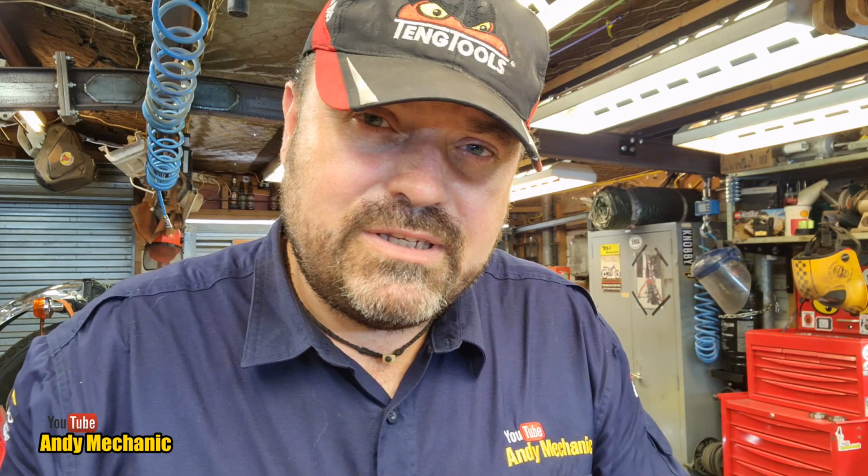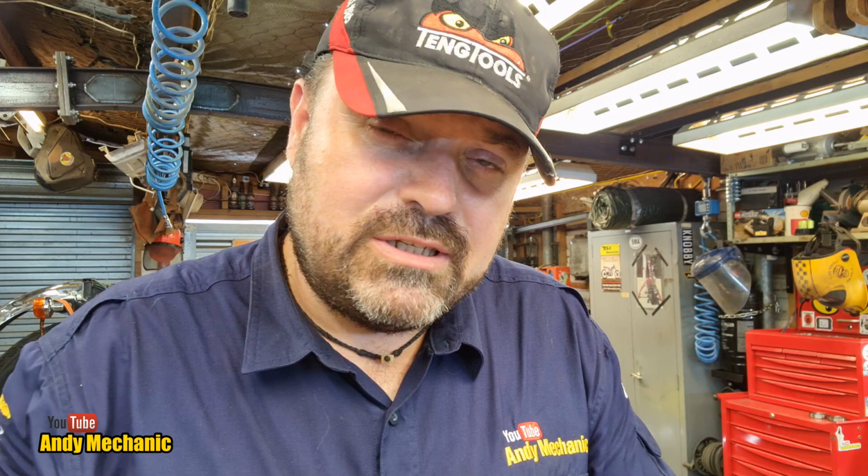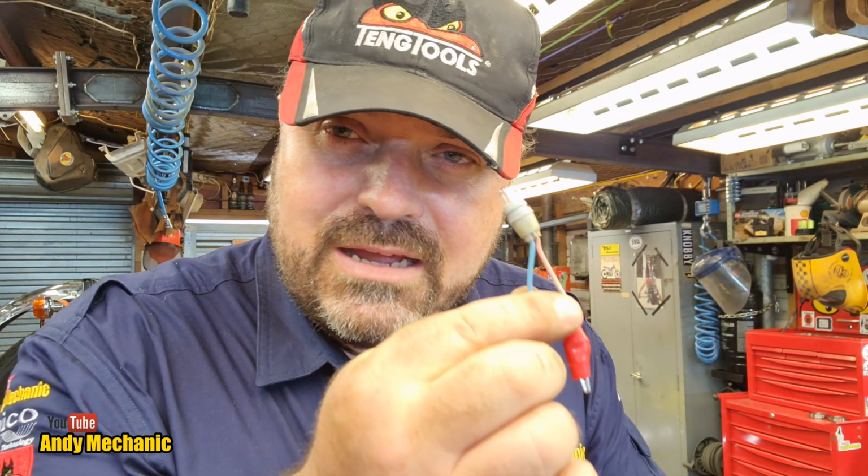And it's done during normal servicing because don't forget, as those heels wear down the points gap closes, and you've got to get in there with your feeler gauge and reset them and usually dress the contactors as well. So, you don't need any real fancy equipment to do the ignition timing. Sure, you could use a strobe light, sure you could use a specialist piece of Honda equipment, but you don't need it. All you need is a little tiny test light.